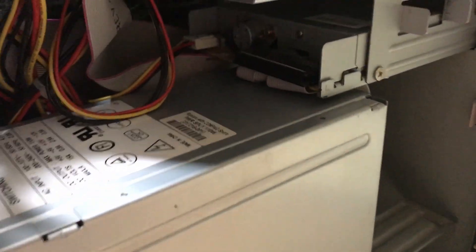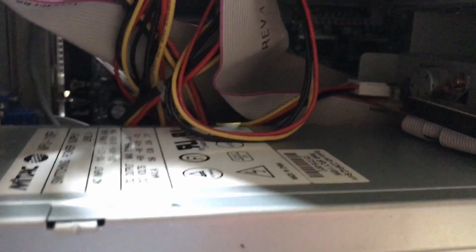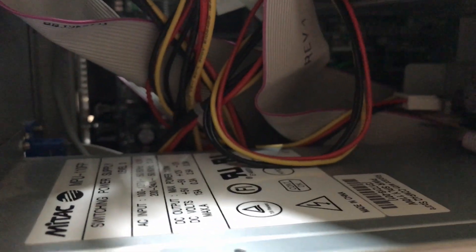And then this slides off. Let's take a look inside the case. On this side you can see into the board, but there's not much. On this side you can see the inside of the computer — again, the power supply is just in the middle. You can see the cables in there, the RAM back there, and under it you can see the expansion card slots. For me, this is just the modem card it came with.